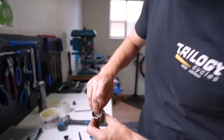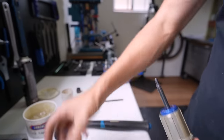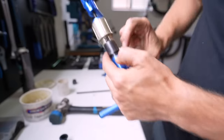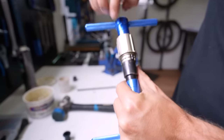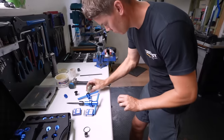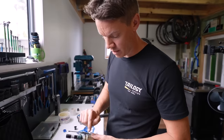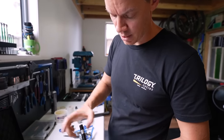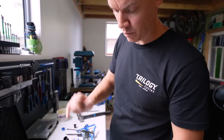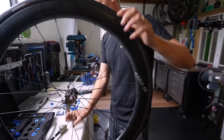The inner sleeve goes between the two bearings, then the second bearing is pressed in — it doesn't need to go as deep. Make sure the sleeve sits equally in the middle. A light thin grease is used between bearings, then a heavier grease is applied where the free hub body sits under load. Excess grease is cleaned off.